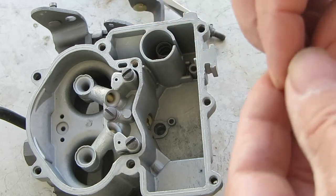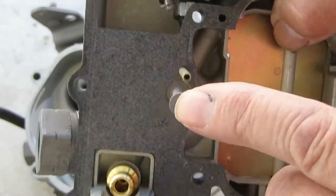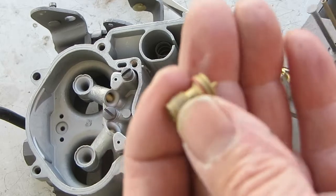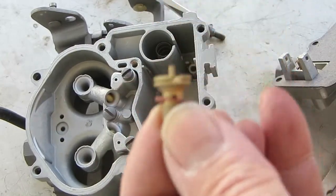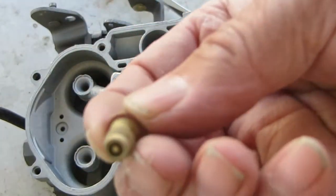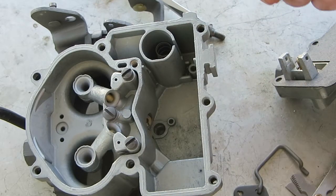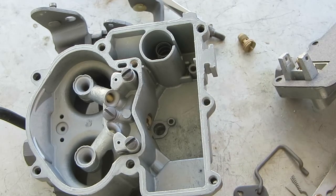That's how it works. The main thing is to make sure that the stem is nice and clean and moves loosely. We do carry these — the power valve — in a couple of different sizes. This one fits almost all the two-jets up until the late 70s, with about a 5/16 thread. The later ones use a larger 3/8 thread. And that's how your power circuit works.